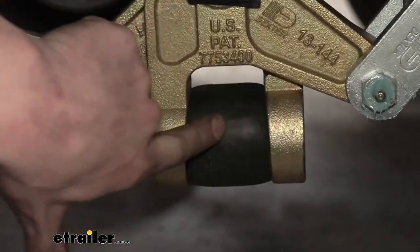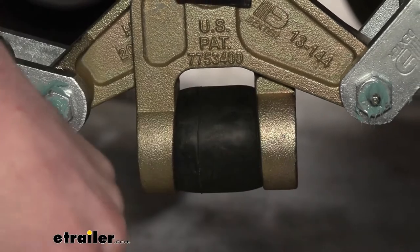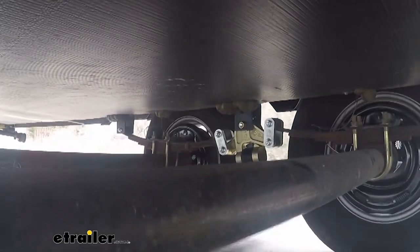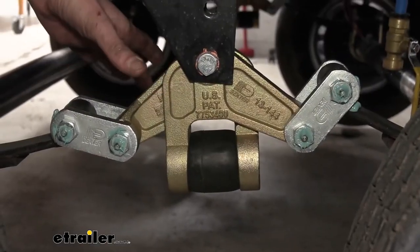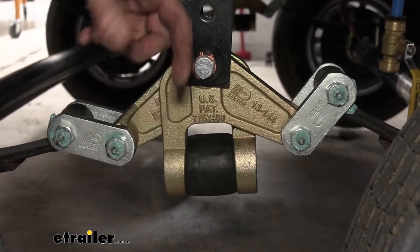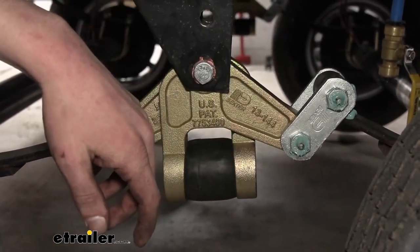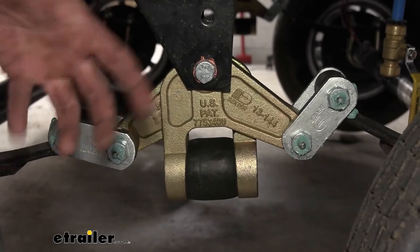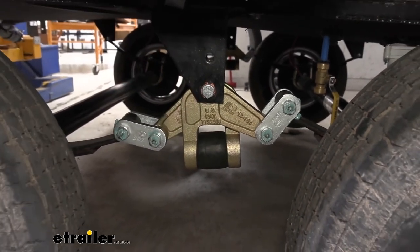You can see the main difference between our old one and the new one. We've got a dampening mechanism in the center that takes the impacts transferred from one axle to the other when you hit bumps on the road. It's a nice beefy rubber piece in the middle that absorbs all that. This is a great upgrade if your bushings are worn out on your shackles or leaf spring ends. You'll not only fix those damaged parts but upgrade them, extending the life of the trailer's components by absorbing a lot of that road impact. Cabinets and other things inside that rattle around will see reduced cracking.